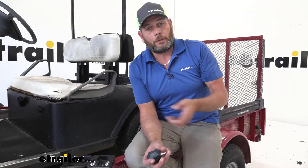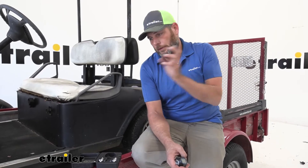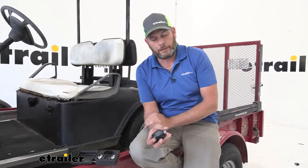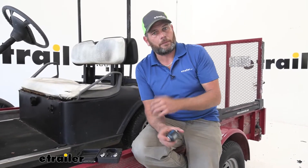It's very important to get things torqued down properly. You don't want to over-tighten them, and you don't want to under-tighten them. We do hitch installs and goosenecks and u-bolts and trailer couplers and jacks — all things of that nature. They all use different size hardware, and by properly torquing them down, you're going to ensure that bolt's going to hold. If we over-tighten a bolt, we tend to stretch it a little bit, which causes it to be weak. If we don't have it tightened up enough, we're not getting enough holding force.